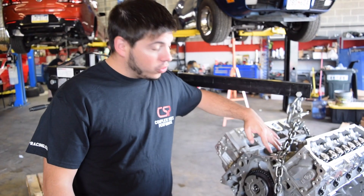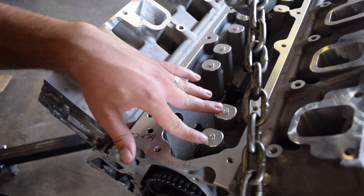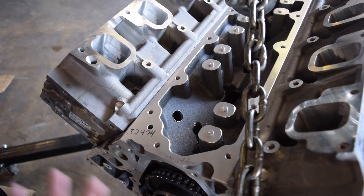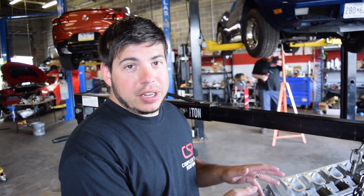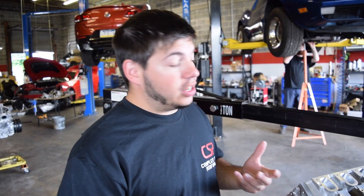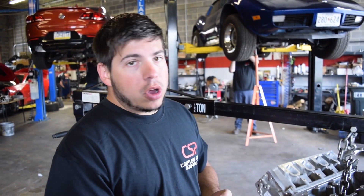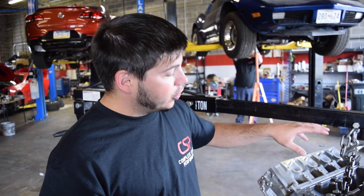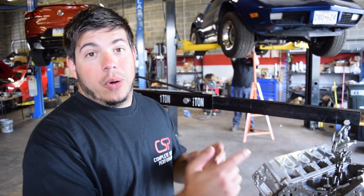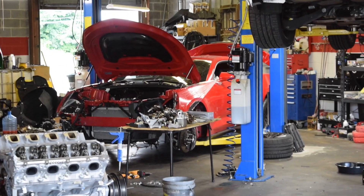All I gotta do is hook up a pickup tube, windage tray - which they also sent the windage tray with actual spacers rather than just stacking washers. There are spacers for this four inch stroke. It is wild. It is a nice kit. You can see we have the DOD block off plugs right here. What they do is, when these cars are built, they have the displacement on demand lifters. This will bleed off the oil pressure so they can collapse and it can shut down to four cylinders. Now the ZL1 doesn't use it even though it has the equipment. This is definitely needed when you do the LS7 or the CPSB racing lifters or whatever other lifter you're putting in. A lot of people do this because it's cheap and completely effective. Other people go with the KTEC Valley Cover - it's a bit more expensive, does the same thing. The only thing with the KTEC Valley Cover is you have to transfer the baffle over, otherwise you get oil sucked into the intake and all sorts of stupid stuff. Next step: getting all that stuff we need on here and dropping it in what used to be a Camaro over yonder. We'll be right back.